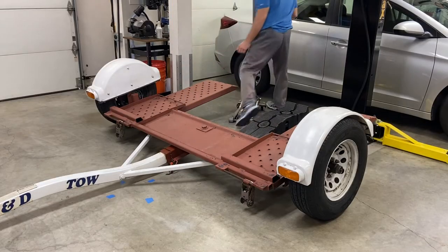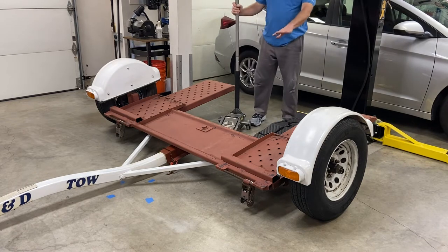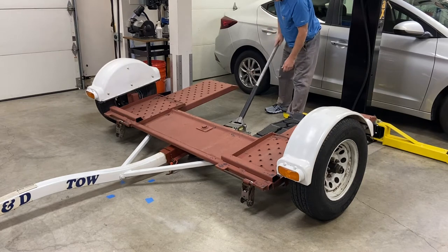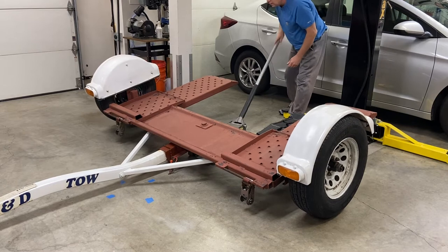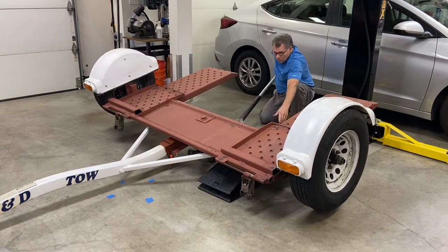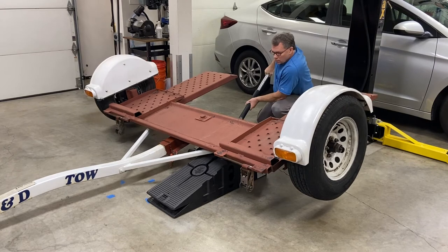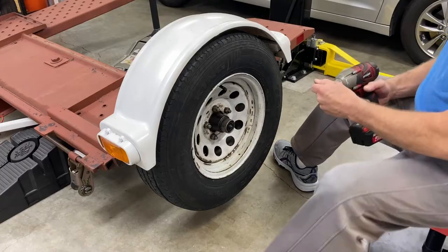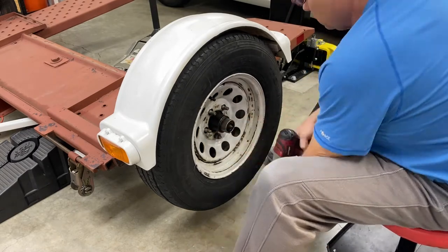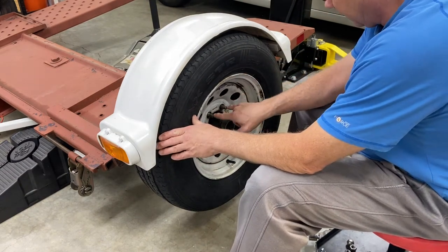All right, let's start by getting one of these wheels in the air. I'm gonna look to pick up the center of this with the jack, slide one of these ramps under the side here to keep that wheel up. I just saw the wheel drop and I took that last lug nut off, so it looks like these are lug centric rather than hub centric.